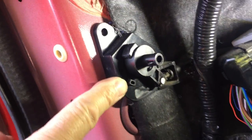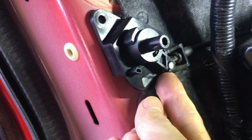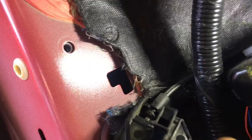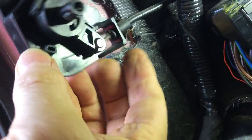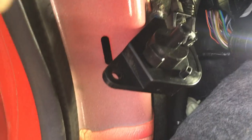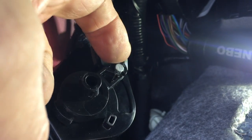There's one little 8mm screw to undo. Then this doesn't just pull straight off — you've got to push it upwards and then pull it towards you. There's a little tab that slides in and goes down when you put it back. Once you've got to this position, you need to remove the cable. You really need to open your bonnet to do this job, so grab a pair of long-nose pliers, grip the cable where the bulb is, and pull — that'll open your bonnet.